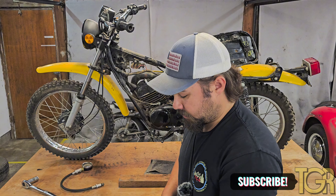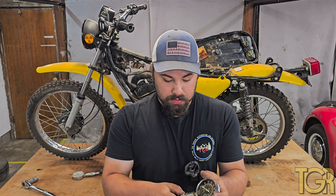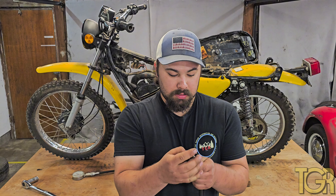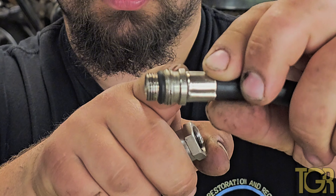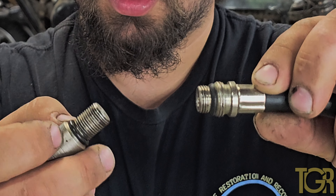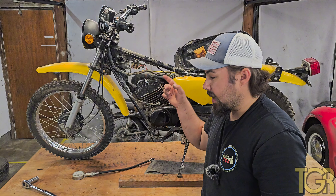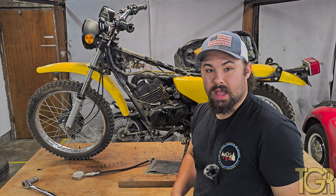30 psi is just not going to do it, but we're going to go ahead and confirm it's still at 30 — you never know, maybe it fixed itself. This compression tester also has a cool little quick-disconnect so you can use it on whatever hose you want, just like a regular air chuck line for your pneumatic air system. It has a little adapter, and I was talking about different size spark plug holes — this is one size, this is another, and this is the one we'll be using for this particular motorcycle. We'll go ahead and take the spark plug out, throw this in, and kick it over a couple of times.